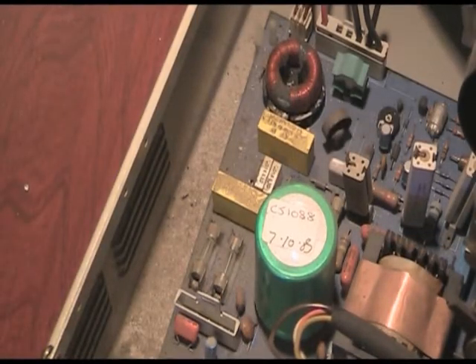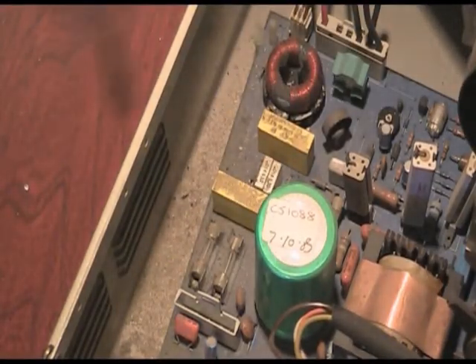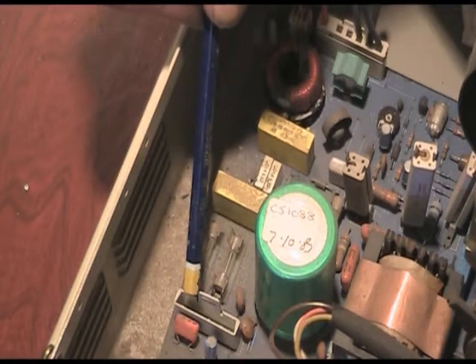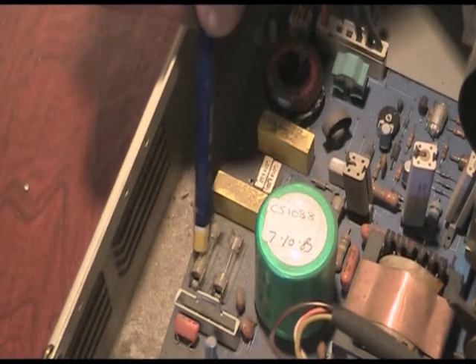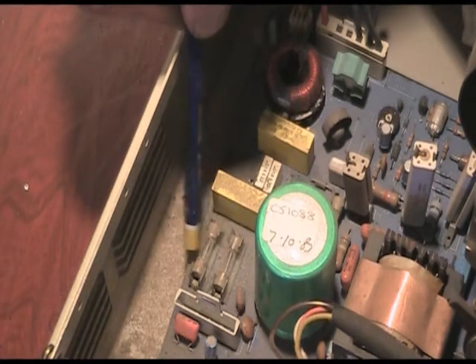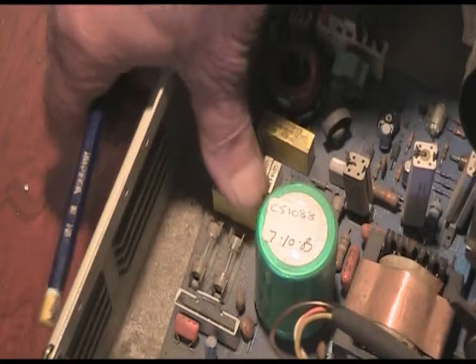Just a warning before we go any further: remember that televisions or monitors with CRTs have got high voltages in there, so be very careful. There's the mains input connector — it may not have a connector, but that's where the wires go to and connect directly into the board. Just after that, on this one there are two fuses — you may only have one. These are glass fuses; you can actually see the wire inside them. Or if you have a meter, you can check the continuity — remove them first before you do, so you don't get any spurious readings.